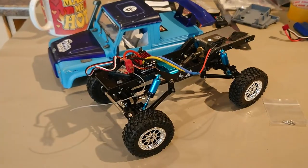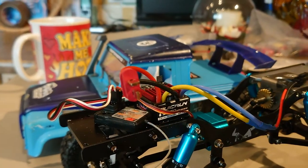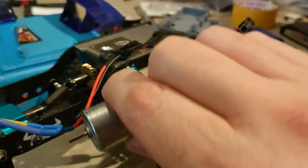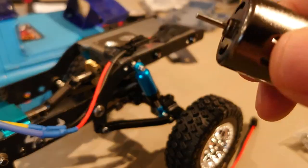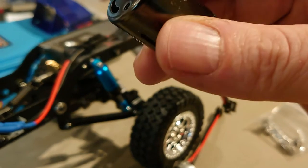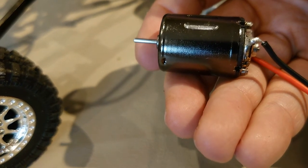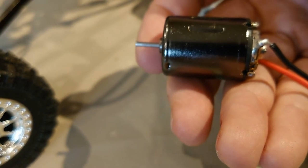The Quick Run 1060 ESC is mounted here — this needs moving, which I'll do in a minute. We've got the motor lead coming up over the top. Thanks to conversations Colin and I had, I have two spare motors wired up and ready to go. This is another 370, exactly the same as the WPL one. And then there's this one — which we are calling the Clarkson — because it is super torquey, super powerful. When we connected it up yesterday it made this thing fly. It would be great for speed runs but I really need to sort the mounting positions.